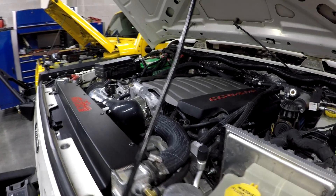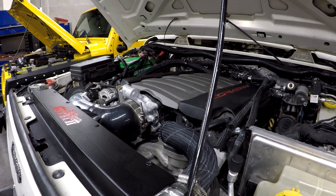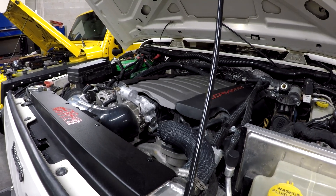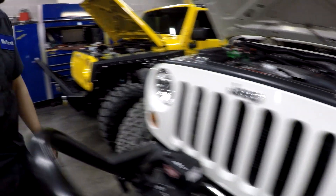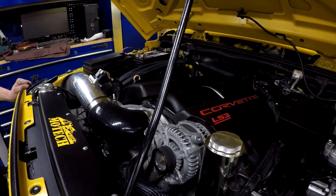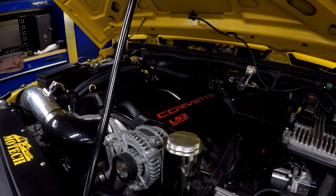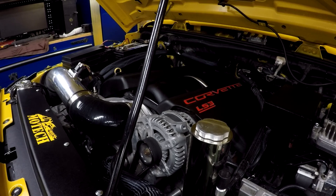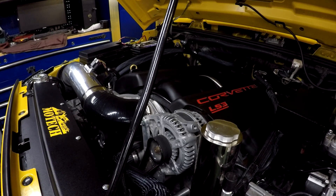One of the biggest advantages of the LT is direct injection. We're running multiple fuel pumps — essentially the stock Jeep fuel pump in the back, which puts out about 60-61 PSI. That pumps it up to the rail, and then an internal mechanical pump steps that up to thousands of PSI so we can inject fuel directly into the combustion chamber. On the LS vehicle, we're running sequential injection — a version of port fuel injection. We pump that 60-61 PSI right up to the rail and feed the injectors direct, shooting the fuel right behind the intake valve. That's how we've been doing it since the inception of fuel injection.